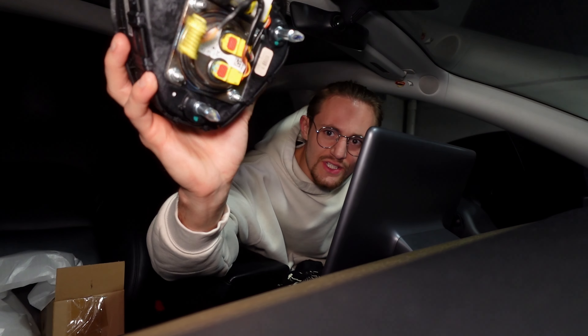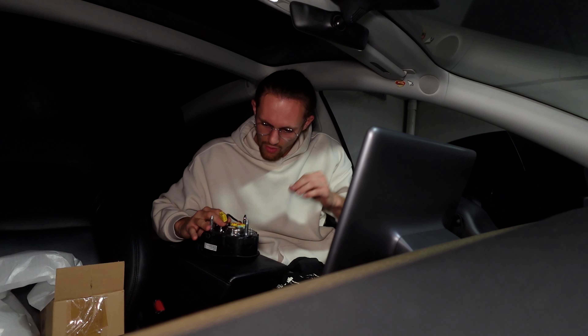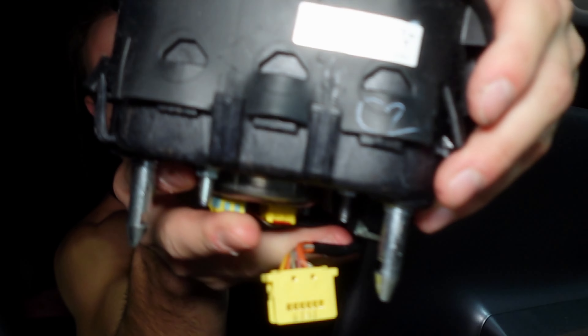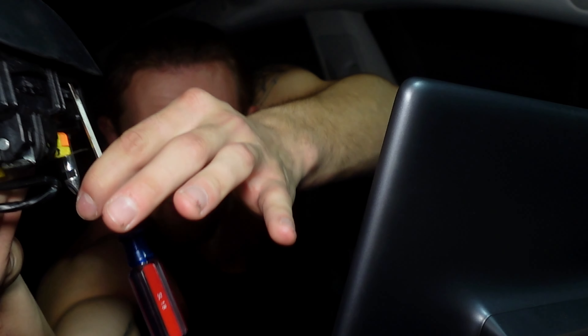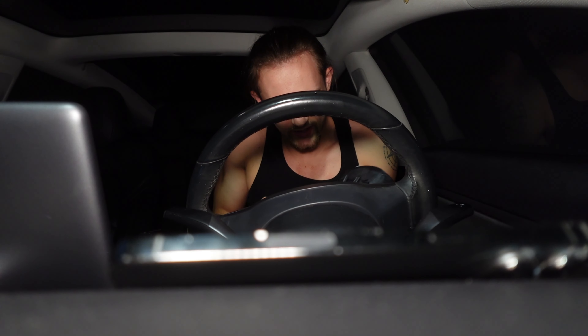So this is the airbag, and all around it are these little pockets. You're gonna pry them all up — that's where the tools come in handy. Those are five extra bucks but I really think they're imperative. Honestly, that was not the easiest thing — it wasn't hard, just tedious. You have these clips around the entire airbag, and because mine had been on there a while it got stuck. I ended up taking a flathead and prying all the way around. This just comes off like that. This is not going to be reusable — I completely destroyed the bottom.